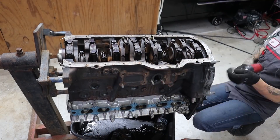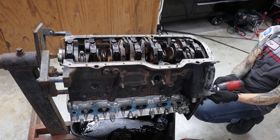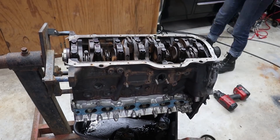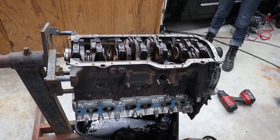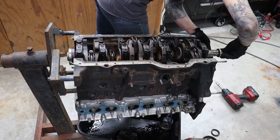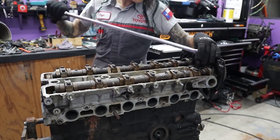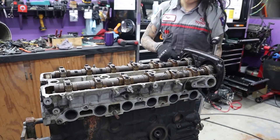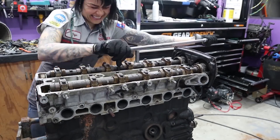In my last video I showed you the disassembly of my donor turbo block and the damage done to it by the previous owner spinning a rod. We had a crankshaft that needed work and a rod that was total garbage. We decided the smartest thing to do would be to get another complete fully balanced rotating assembly — crankshaft, rods, and pistons — though we likely won't be able to use the pistons. The GE and GTE pistons are different, and the cylinders will probably need to be bored over due to visual damage. I haven't taken measurements yet, so we shall see.